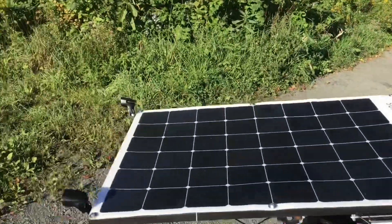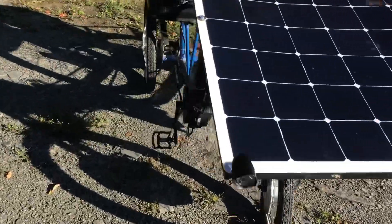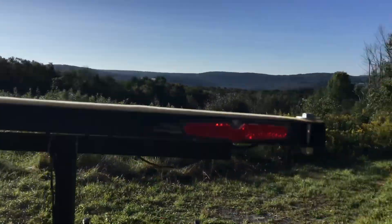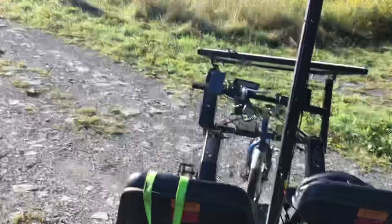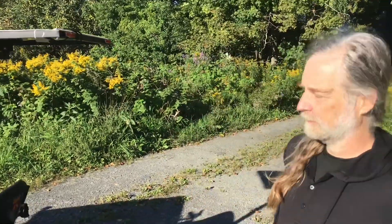You can see there are headlights on the front panel and lights on the back of the panel too. Those are from Electrify — the TSDZ motor has a connector through the speed sensor that provides six volts for the lights, with all waterproof connectors, which is great for a long cross-country trip.